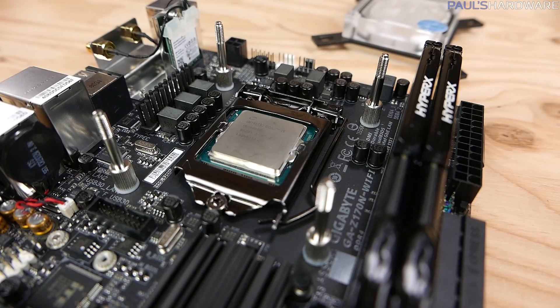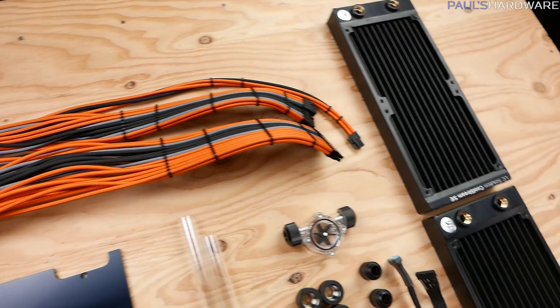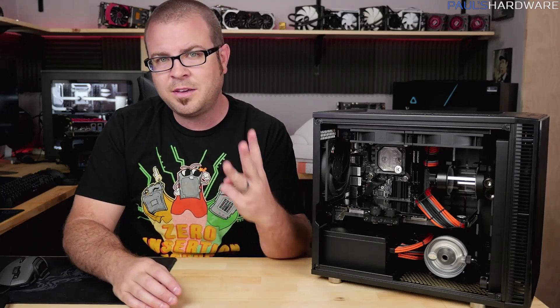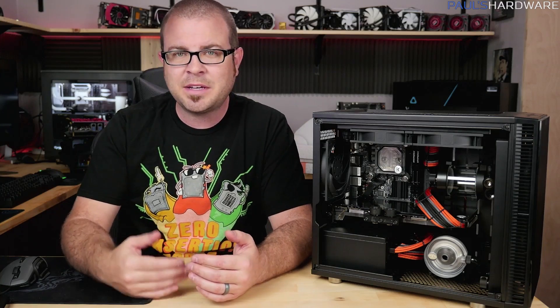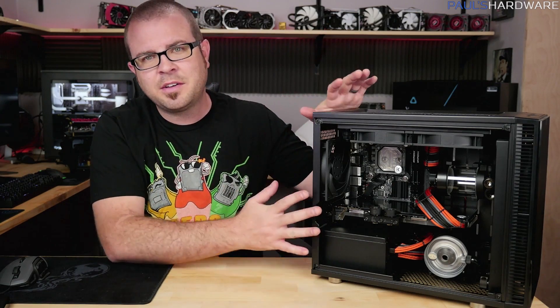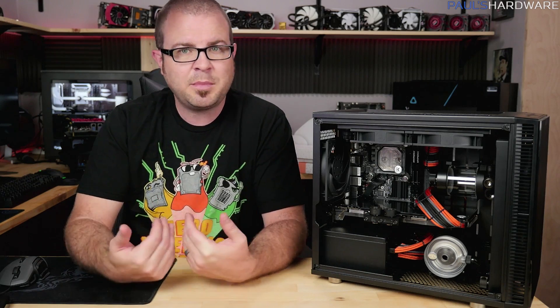The sponsorship is one factor, but also I'm using a motherboard that isn't necessarily high-end — it's about a $150 board from Gigabyte. Even they asked if I was sure I wanted to overclock on it. I chose it for aesthetics and because it has both WiFi and M.2 built in, but it only has a three-phase power delivery system. I've added some heat sinks to help, but it's not the best overclocking board. I'm still confident it'll get me to around 4.6 or 4.7 GHz on the 6600K.